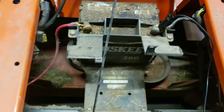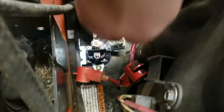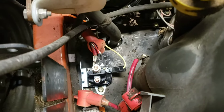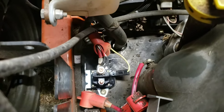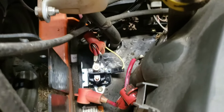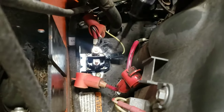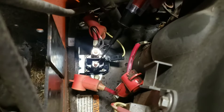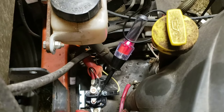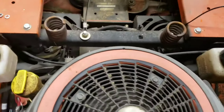I'm not even going to put the test light on it yet — as you can see I left the wire going to the starter off, just to verify this works first. I'm going to put the test light on it; if it works you'll hear it click. There it is — every time I turn that key I'm going to have 12 volts right there. So let's just try it — there it is. Simple fix, wasn't that bad, just had to know what to look for.